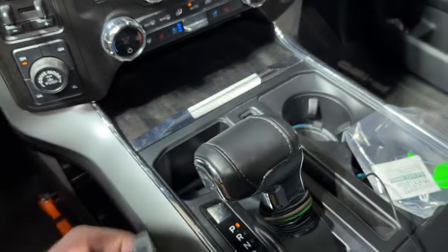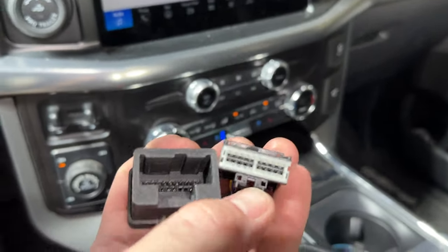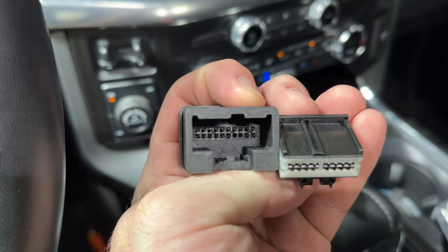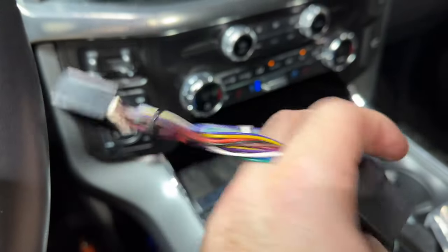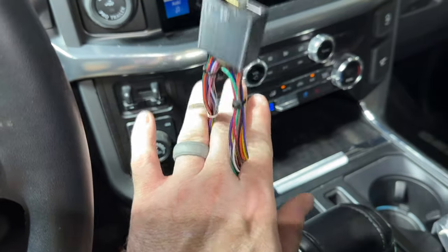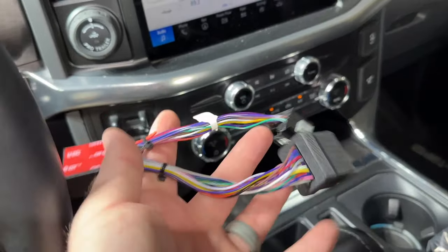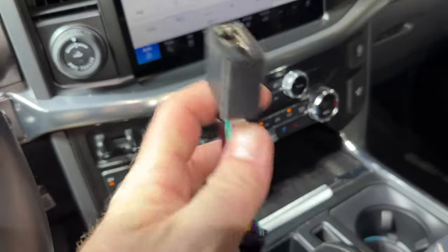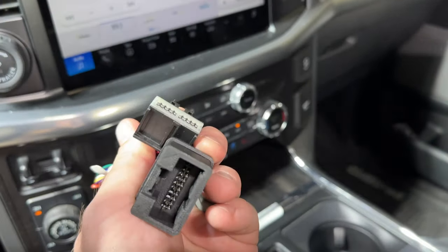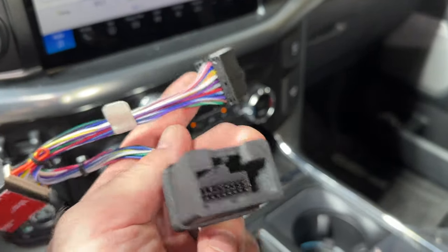What we're going to do is locate the IPMA or the APIM — I'm not entirely sure which one we jack into here; we'll find out when I get there. This basically intercepts the signal from the Ford module to the steering wheel and then injects signals from the Comma into there. The Ford system will still be active — the Comma just intercepts and interjects its own signals. Any time we turn Open Pilot off, it will pass the Ford command straight through. The connectors are the same, so you plug this into the box and the box plugs into the vehicle.